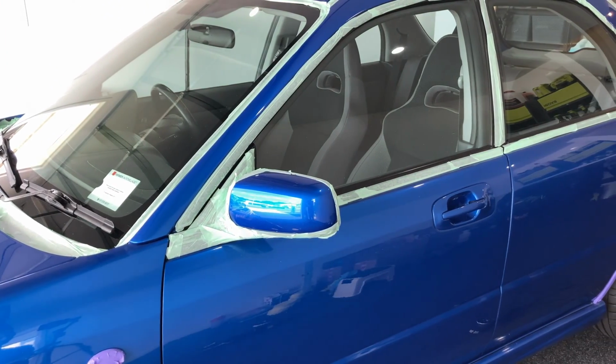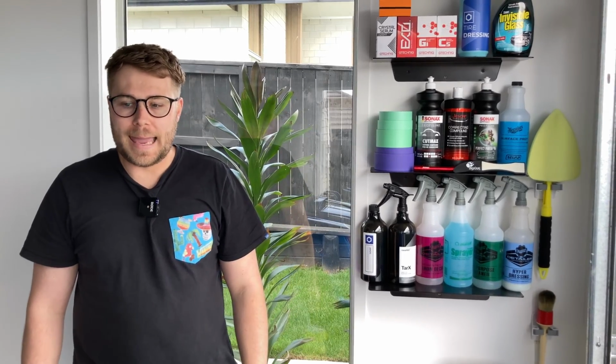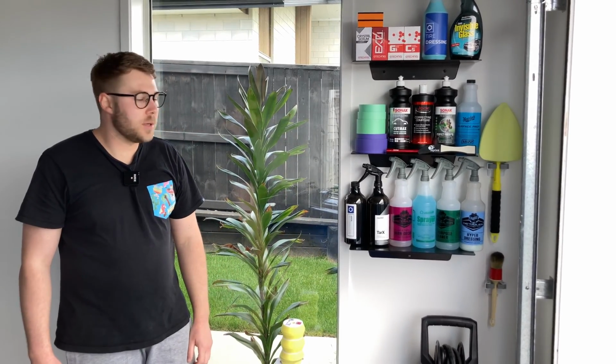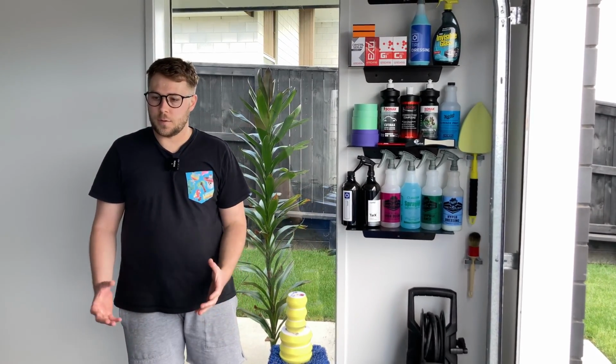What we're going to do now is start into our finish polishing. So we're going to be using Sonax Perfect Finish, and that's got a pretty low cut, a cut of 4, and we're going to be using it with our Rupes fine foam pad here. The Sonax Perfect Finish has got a really nice finish. It's going to finish it to a finish of 6, so really high gloss, so hopefully we bring that richness out of the paint.